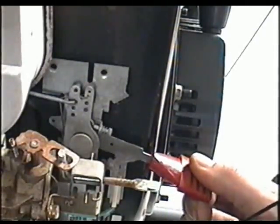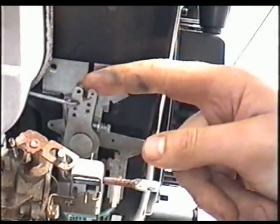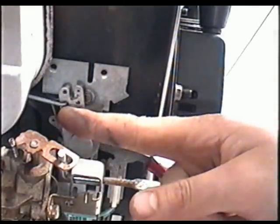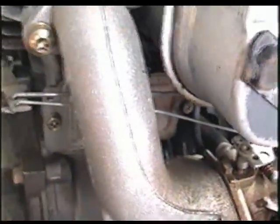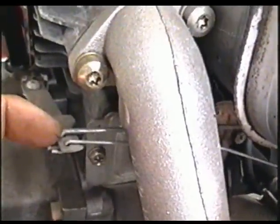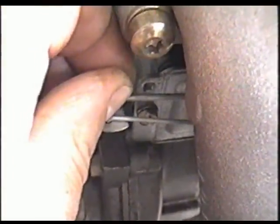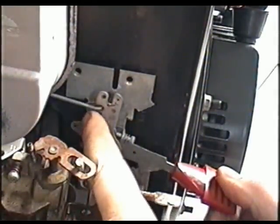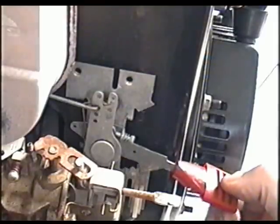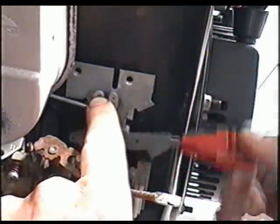What's happening with this YouTuber's snowblower engine is when he moves the throttle lever, this mechanism which holds the linkage that goes to the governor goes right under here and hooks up on this side of the governor arm. This is the linkage we're talking about. When he moves it, nothing happens — he puts up the throttle and this thing just stays over here like nothing happens.